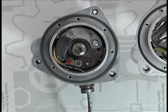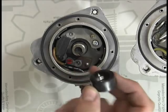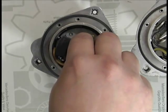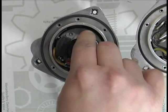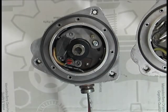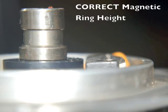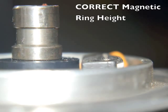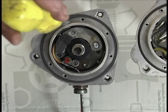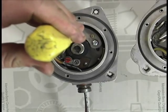This is where we find the most problems with the installation of the igniter. The magnetic ring sits down over the six lobes of the distributor shaft. The most common no-spark conditions are usually a result of the alignment of the magnetic ring in relationship to the pickup box. Here the magnetic ring is not fully seated. The correct magnetic ring height is flush with the top of the pickup or slightly below the top of the pickup. You now need to set the vertical spacing between the pickup module and the magnetic ring.